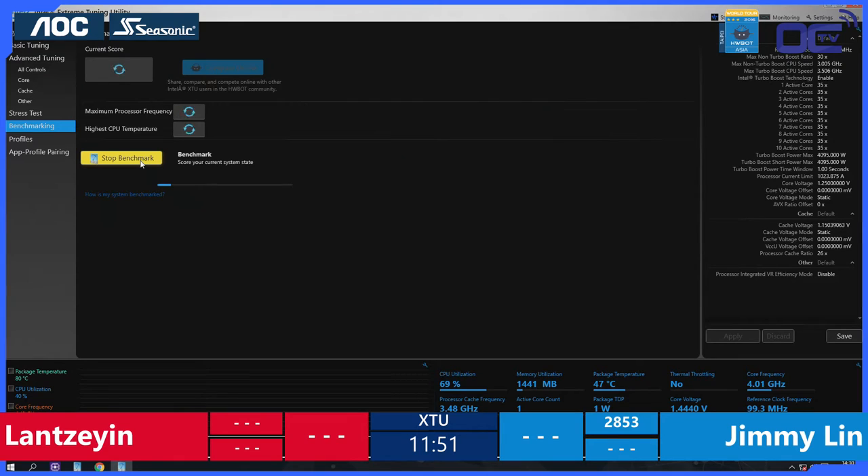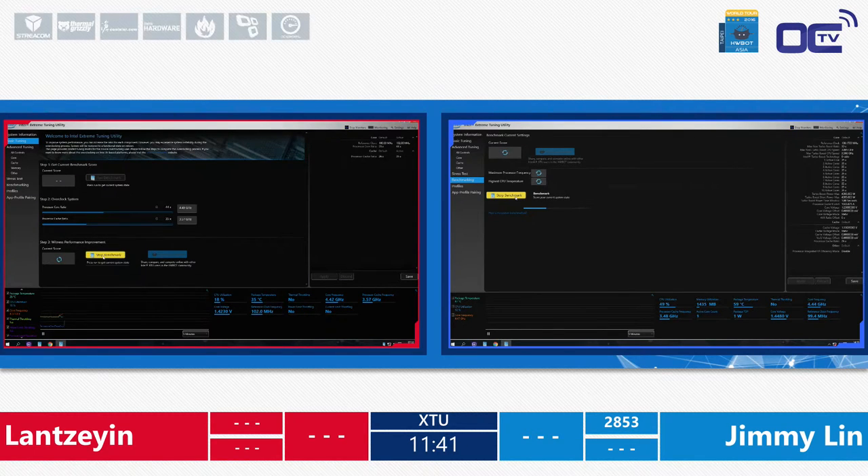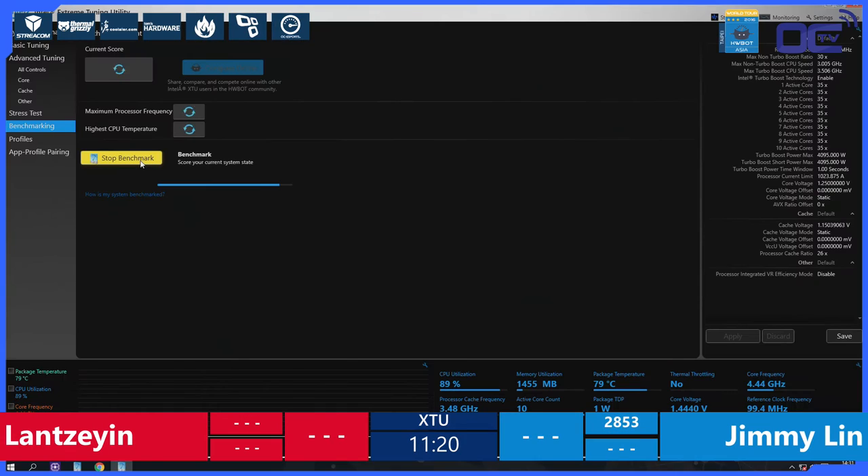He's slowly increasing settings — we've seen him talk with his friends in the audience who took notes or even pictures of what was going on on the big screens. He will probably reach close to 4.5 GHz on the CPU. These systems are cooled by a standard all-in-one cooler from Thermaltake — the Extreme 3 with three fans, a 360mm rad — just something basic, not even really high-end water cooling, and still able to cool these Intel 10-core CPUs pretty well.